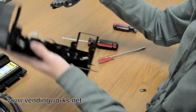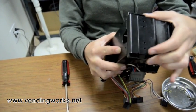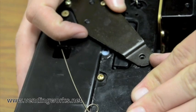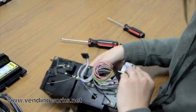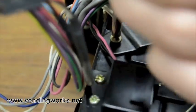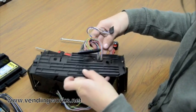Put your two large pieces back together. Insert the bottom part in until the bar goes over it, then lift this up, push the belt box in, and drop it back down. Then you've got to put your brass shoulder screws back in — you've got to line up the circle to make sure it goes in the right way. Start putting the control board box back on. Take the flat piece, put the cords in, and put your screws back in.